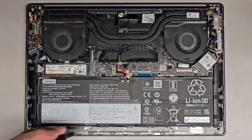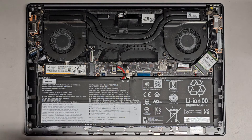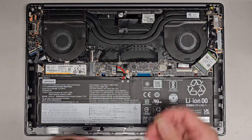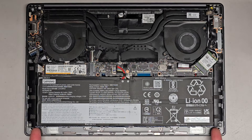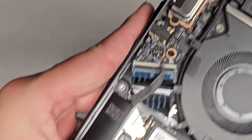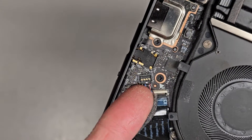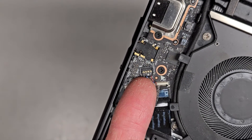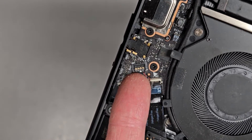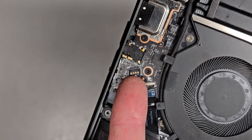We're undoing all the screws for the speakers as well. The speaker screws are wider and flatter. There are two more battery screws — one there and one here. Now that we got all the battery screws out and the speaker screws, we're going to carefully lift this up. There is the speaker cable connection here — it's a flat cable, and this is the kind where you get underneath and then pop that up. Get underneath with your fingernail or a thin tool, making sure you're not prying up the outer part of the connector — only prying up the middle piece. Get underneath and it should pop out.